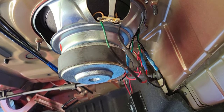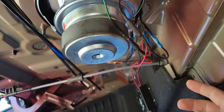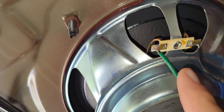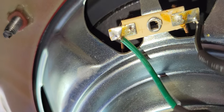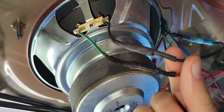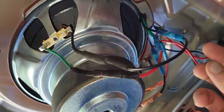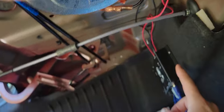From under the trunk, you've got your right and left wires that you have to tap into for your line output converter over here. These are labeled positive and negative. You can do the other test where you connect a 9-volt battery and see if it goes out or not. You're going to need to attach some jumper wires for length, so when you cut them in half you'll need extra length to splice in the new wiring — get some heat shrink and melt those down.